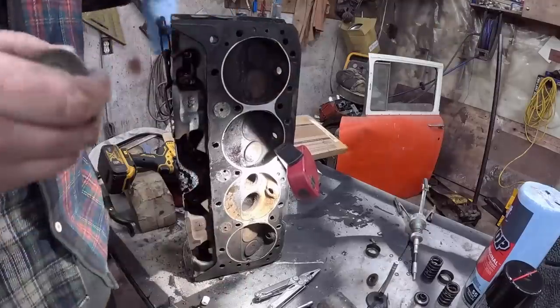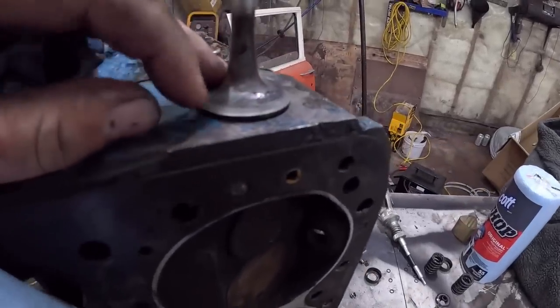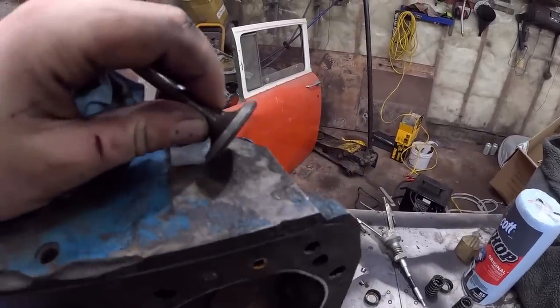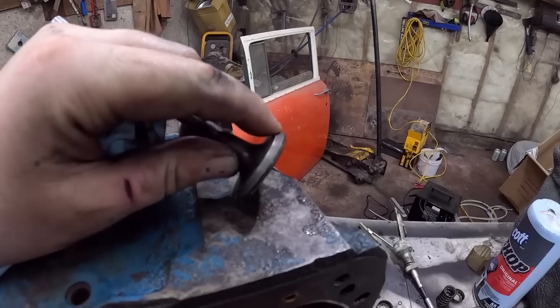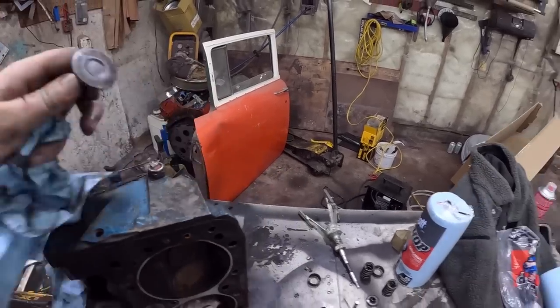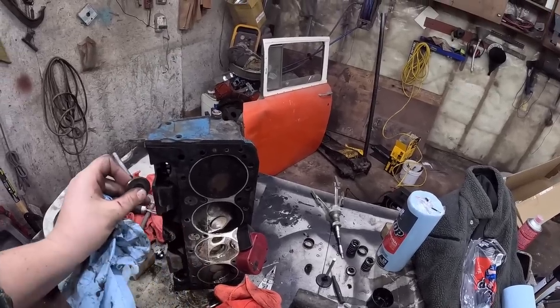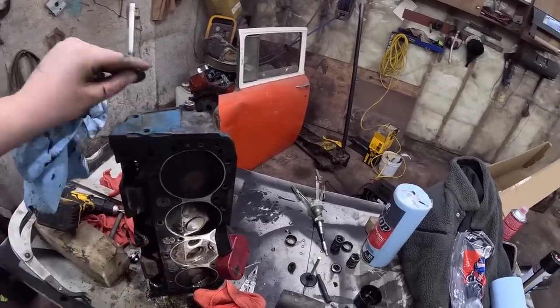But the cylinder head needs to be cut for sure. But I'll work at this for the next 6 hours and see where we end up. So, a quick update. The valve here, we're working into it. Now what's happening, hard to see. It usually has like a flat edge. We're starting to have a bit of a step down, which is the same thing that happened to that guy in that video I watched. Because what we're doing is we're pulling the valve further and further into the head, which is not really what you want.